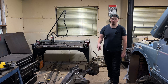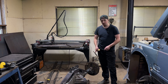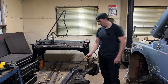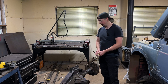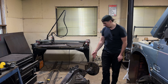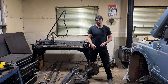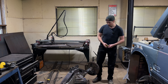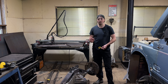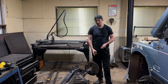Last night I was able to finish off these mounts. I put the lower link mounts onto the axle and positioned them just like they are in the four link calculator. The numbers I ran: 20 inches in the Y direction — from the center of the axle housing out to the center of my mount. We dropped it about an inch below the centerline of the wheels, sitting at 17.5 inches off the ground. And the X distance is about 3 inches because we have a 3 inch round housing, with the mount placed about an inch and a half away from that housing.